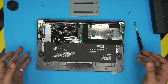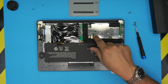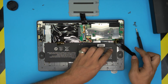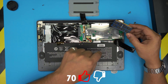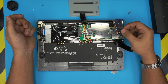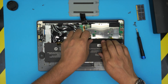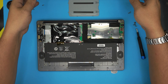Inside you've got a humongous battery and a motherboard — it's pretty much like a tablet in here. Let me remove this tape so you can see clearly. There's nothing here in terms of upgradeable RAM; there is no RAM DIMM slot. Everything is soldered on the board and there's no space on the other side to place any RAM either. The only upgrade you can do is add an extra hard drive right over here. That's it — there's nothing else we can do.